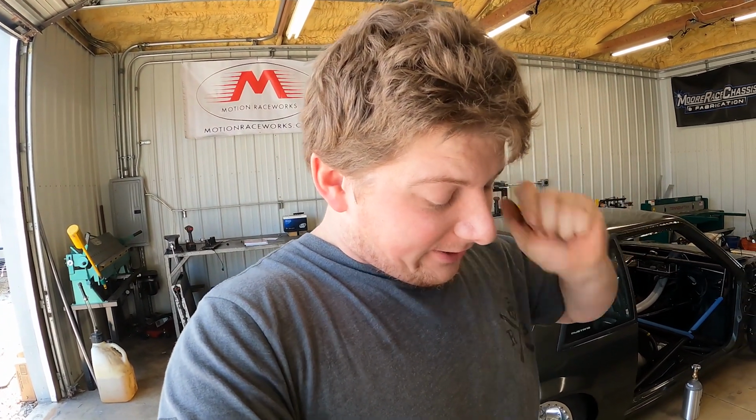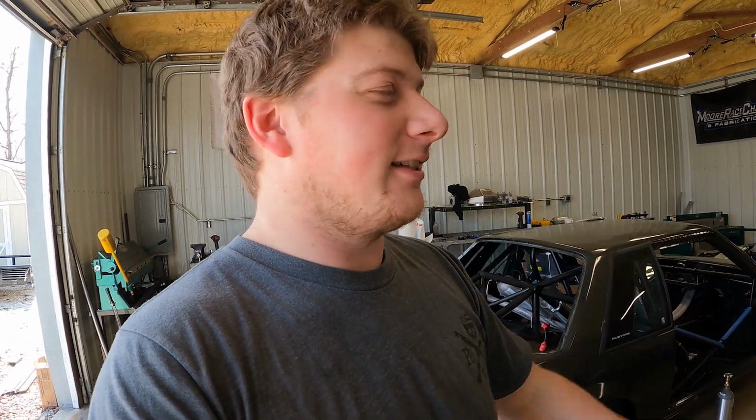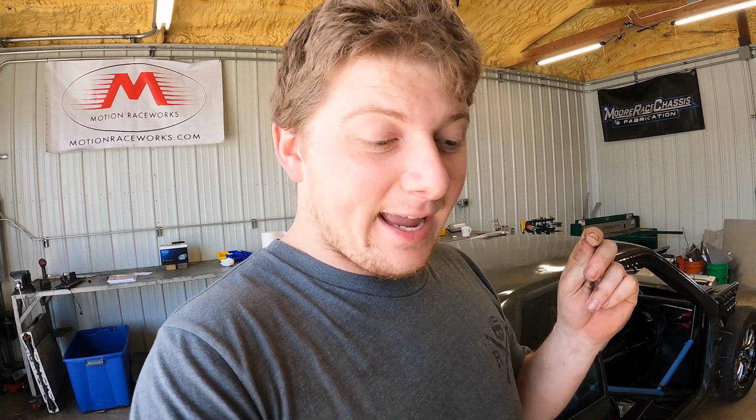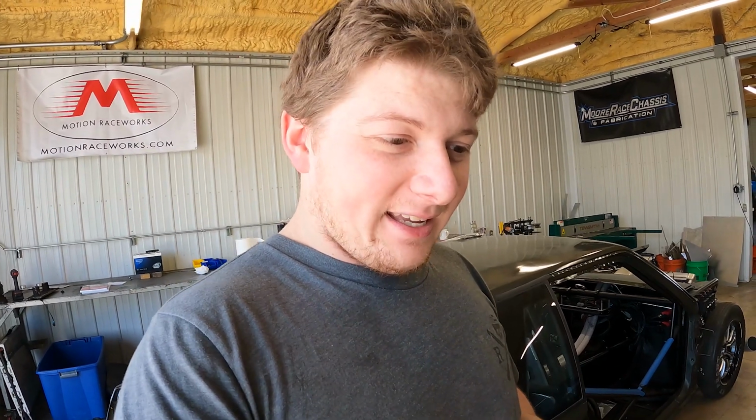So I'm here doing gear things. The axle we're putting in the car that came out of the black car has 273s. The housing that came out of the drum brake car has 373s, which is a whole lot better for what we're trying to do. I'm just going to start taking things apart and hoping the axle splines are the same. They're both the same carrier, as far as I can tell.